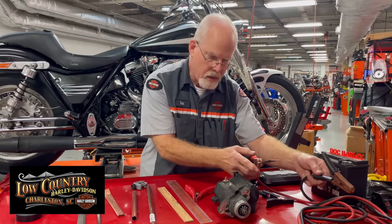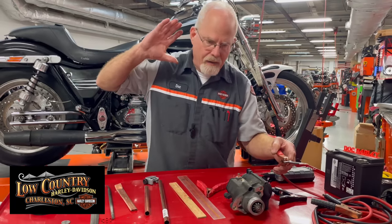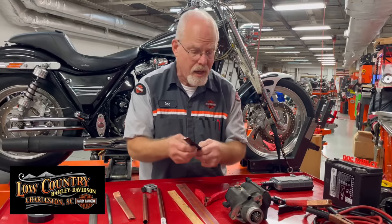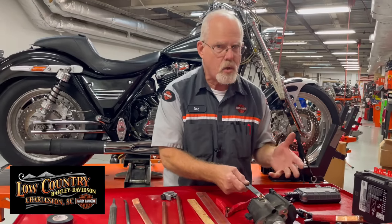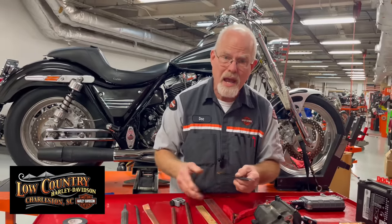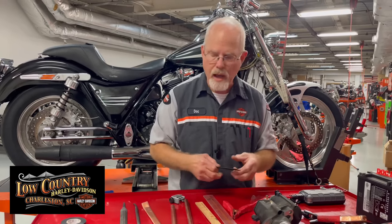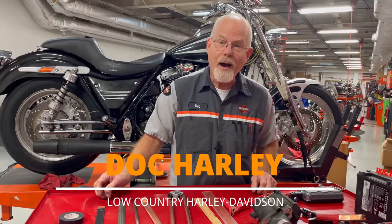The ground part of the jumper cables goes to the frame of the motorcycle, and that completes the circuit. All you want to do is have this connected long enough to get it started — you don't want to overheat the copper tubing inside. Omar says his tool has been lasting three to four years. This is a viable tool you could have to help jumpstart your motorcycle without getting to your battery. As always, this is not endorsed by Harley-Davidson or Lowcountry Harley-Davidson — it's something sent to me that I wanted to share. Keep it in your saddlebag. Otherwise, if you've got a dead battery, take it out, charge it properly, put it back in, and you're back on the road. Just a little tech tip from a viewer. I'm Doc Harley — we'll see you next week.